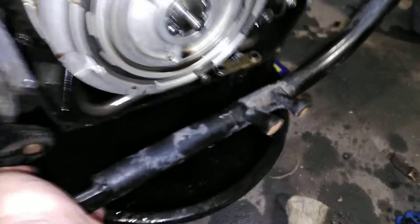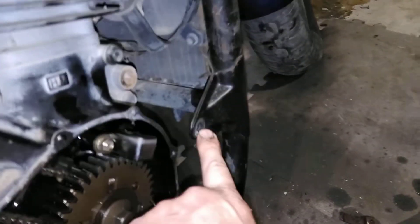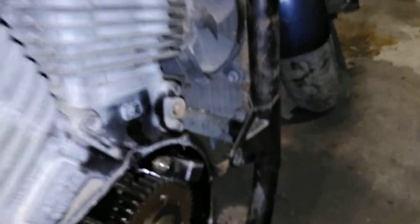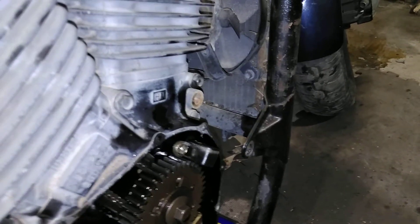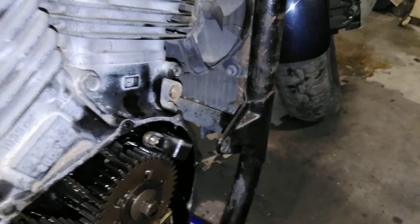I'll tell you some of the pain and suffering I went through yesterday to get the side cover off — that's no walk in the park. Down there is the side brace frame, and to get that off, there's a bolt that goes through here, through the engine, and out the other side. Some engineer decided that bolt needs to go out the other side, so you have to take the exhaust off from both sides to remove it. I had to take the exhaust pipes off of both sides.